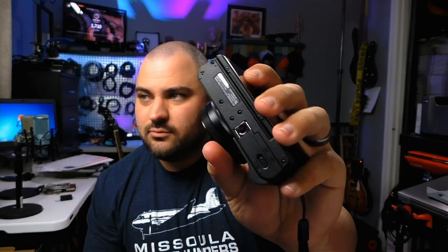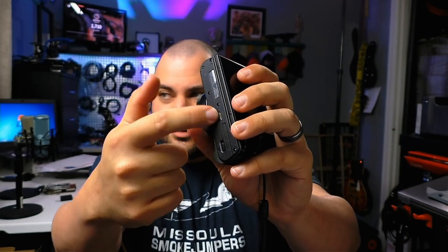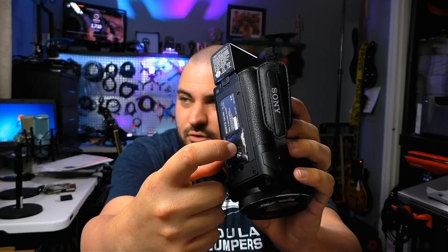This is a warning: with any camera, make sure the tripod mount is solid. Here on my RX100 Mark V, that's a metal bolt secured directly to the body with no plastic dependence. But on the Sony AX53, it's one tiny screw that goes through plastic to reach the bracket, so it fractures along the way. If you're going to put this on a tripod, just be careful — it is a fragile area of this camera, unfortunately. That's the nature of the beast.